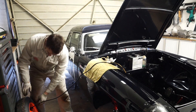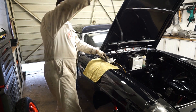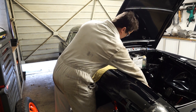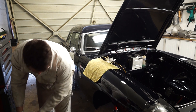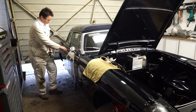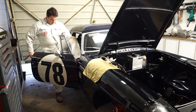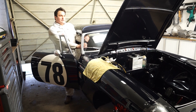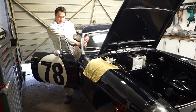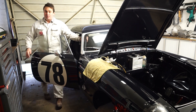With the driver's side done I can unclip the Easy Bleed from the tyre. Before I disassemble everything I want to check I've got a nice firm pedal that's not moving at all. It's a nice solid pedal — also making sure it's not pumping up and not creeping down as I push it to the floor. That feels pretty good.